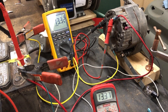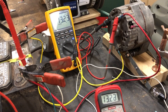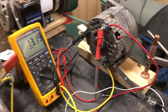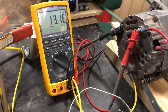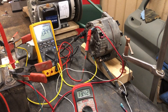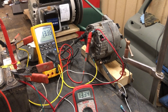You really only need momentary power to start the alternator charging — to excite the field windings. After that you don't need that power going into it; it generates its own 12 volts, which is why the indicator light goes off. If you don't have that exciter voltage when you turn it on, it won't output any power. As long as the engine's running at speed, it'll maintain the alternator output to charge your battery and run your electrical systems.